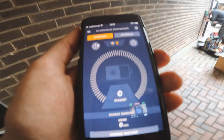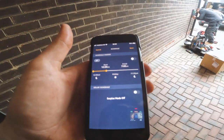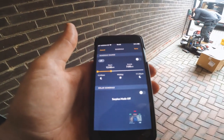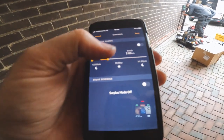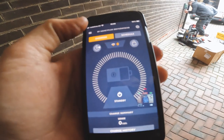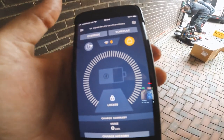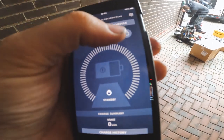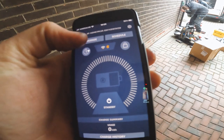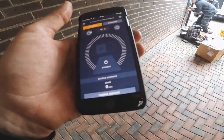That's the app up and running. In the app you can go onto the schedule and charge your car between certain times — you might find cheaper tariffs, like an off-peak 4am tariff at half the price. You can set that up, or if you haven't got that you can just pick override, or even lock it so people aren't using it when you're not charging. If you want to use it and you're not bothered about the schedule, just leave it unlocked and set it to override, and as soon as you plug in it'll start charging.